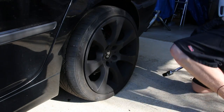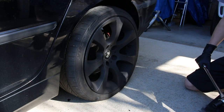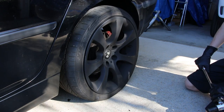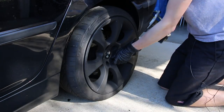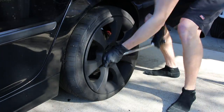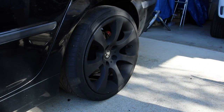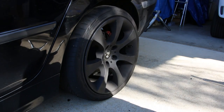We're gonna do this one side at a time. Before you even start jacking up your car, you want to break loose these lug nuts — they're pretty tight and it's just better practice to do this on the ground. The key thing is you're not taking them off, you're just breaking them a little loose before you jack the car up. Grab your breaker bar — you can do this with a ratchet, this just helps you get a little better grip — and just pop the lug nuts loose. Now we can go ahead and grab our jack. You can either use a pump jack or the one from your trunk — either one works.